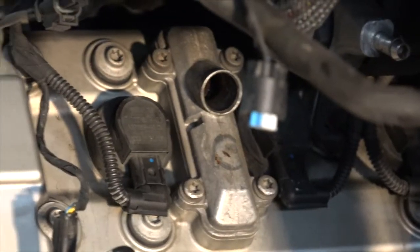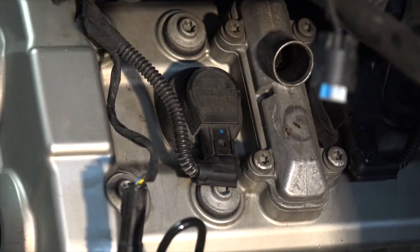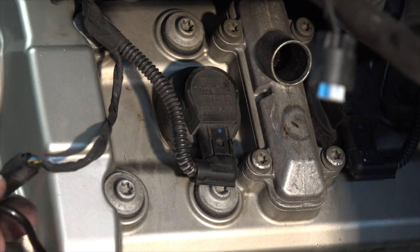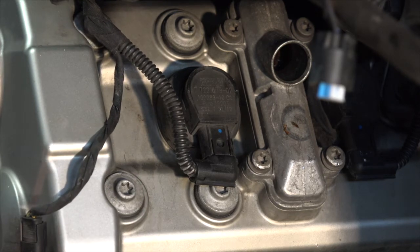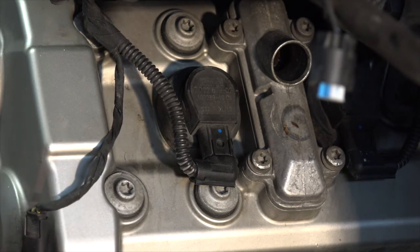One of the other things that I need to do is replace one of these coils. It's number 5. I've got a code for it. Unfortunately, there is no information in the manual that I got with this bike. So I went to all the forums. Pretty much anything with that code in it, I think it's a 21FE22, they're saying replace the coils. I really would have liked to have thrown a scope on there to see what was going on. Unfortunately, the lovely manual that I have, to the best of my knowledge, has no wiring schematics in it either. So I was hoping maybe to tie into a fuse, get a current ramp or something. But again, I've got nothing. So we'll replace number 5 coil and see if it cures the problem anyways.